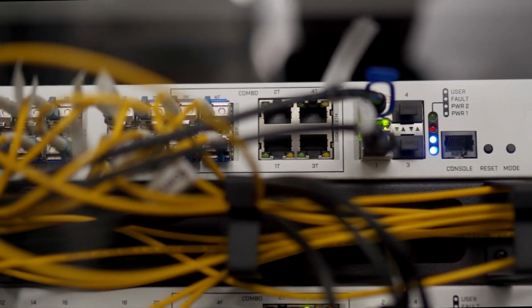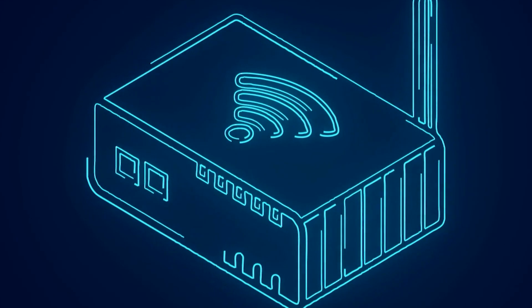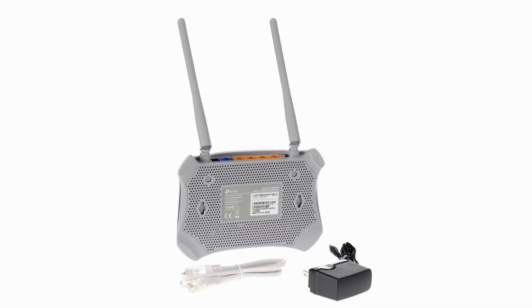There's typically nowadays routers that do both 2.4 and 5 gigahertz, but there's also the old school ones, which are 2.4, which is what you need for this. And then there's new ones that just do 5. And if you just have a 5 gigahertz router, this will not talk to it. It's because the little switches in these things generally only talk on the 2.4 gigahertz frequency. So before you buy this, make sure that your router does 2.4 gigahertz. That's my big advice to you.